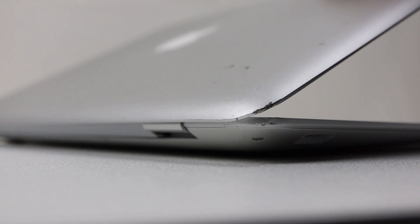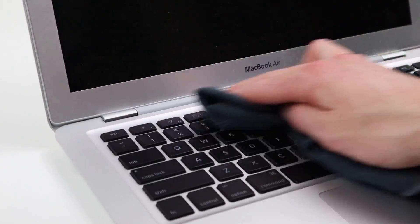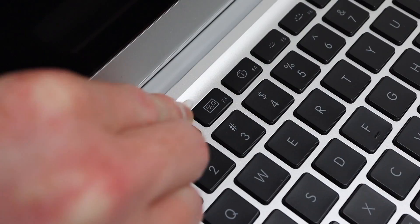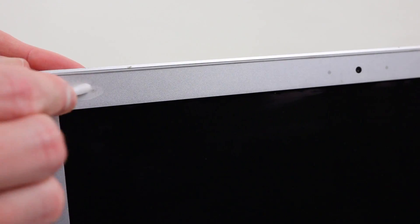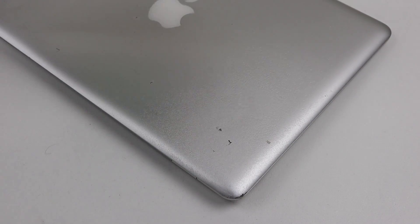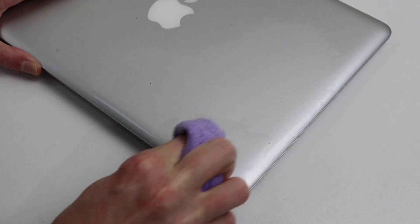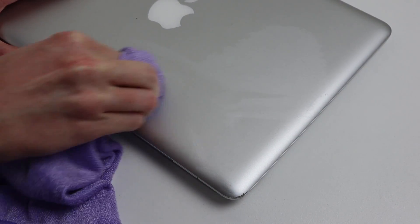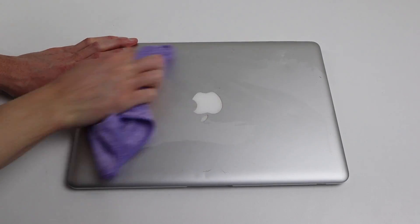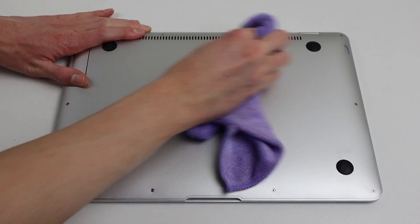You need to do this slowly, as applying too much force can cause the casing to snap or crease. But two minutes later, it's looking much better and is no longer scraping. However, this won't remove any of the scratches. The last thing I'll need to do is give the laptop a good clean — it is quite dusty and has a bit of grime on it. Using some more alcohol, I can clean it up and make it look quite nice. If you purchase any electronics used, you should always clean them before use, as you don't know where they've been or what they've been subject to. I was quite surprised, as a lot of the marks on the exterior casing that I previously thought were scratches turned out to be just grime and dirt build-up, so the laptop ended up looking a lot nicer than I thought it would. And after a good clean, we're done.